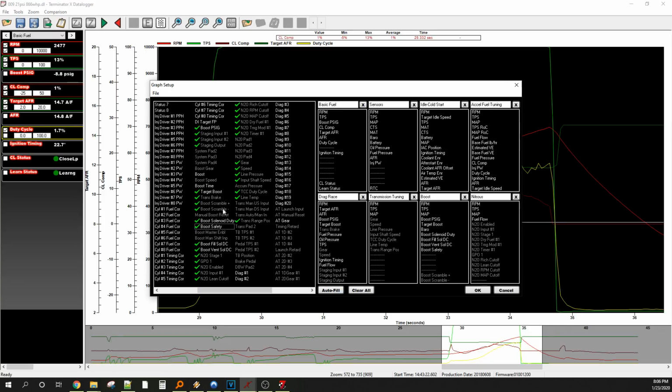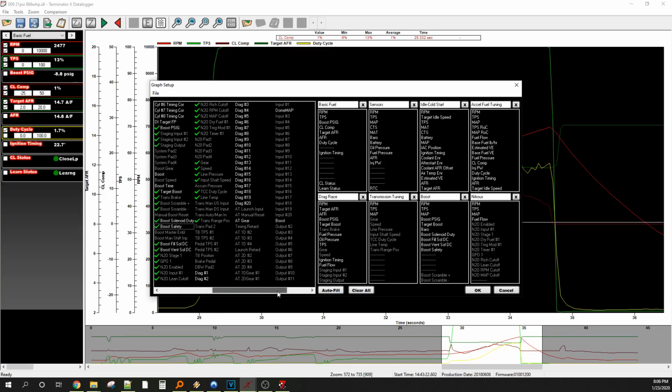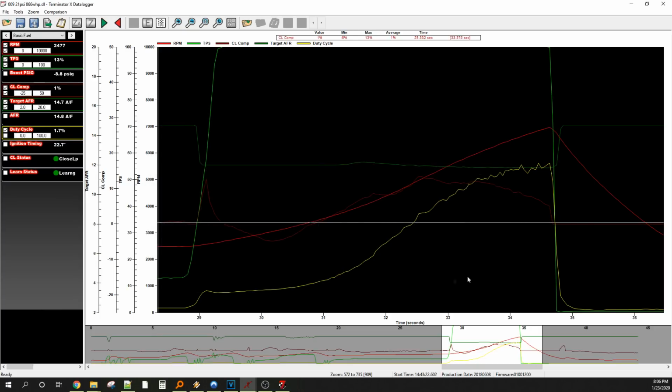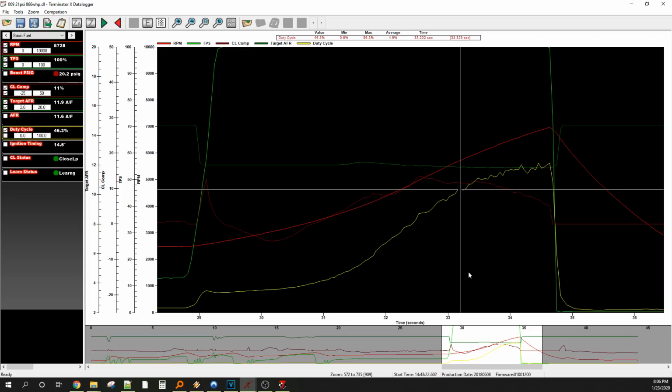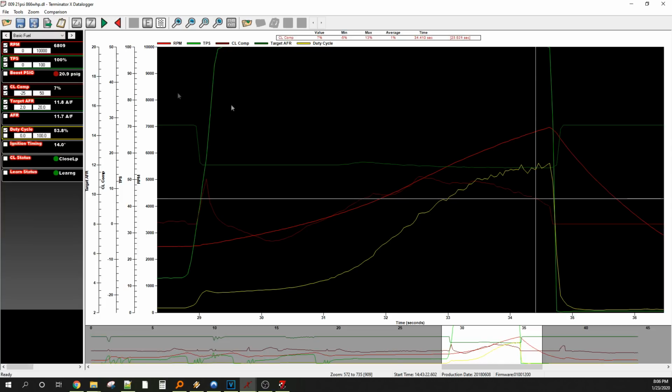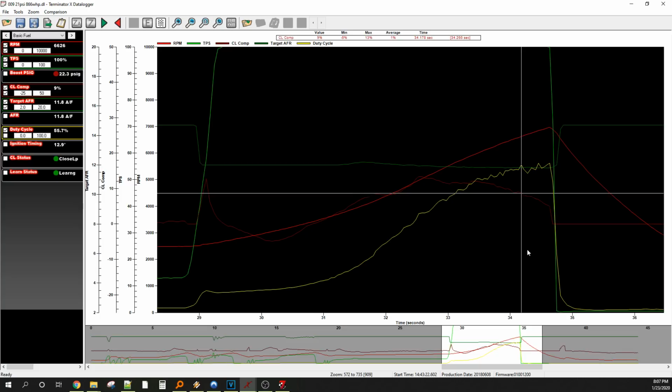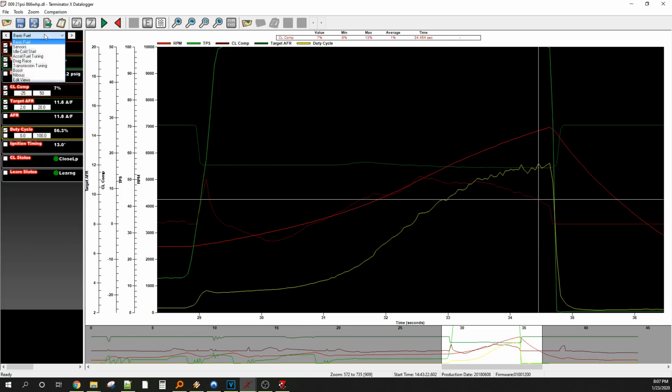Boost scramble, boost. I don't know, guys. We just won't worry about the exact percentages. So up here you can see 20 PSI, adding about 11% on the closed loop, 10, 8, 9, up top it has a decent amount. So this thing did not take a bunch of ignition at all. It was really making great power on lower ignition. 20 pounds, 14 degrees up top, and 54% of the injector.